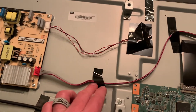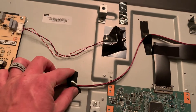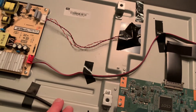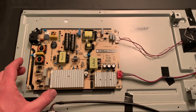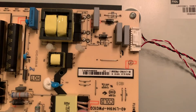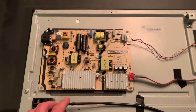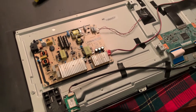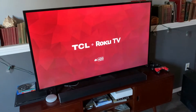At this point you may also want to look at the tape holding the cable routing together. Sometimes it gets loose — you can retape it with some electrical tape if you want. It's not super critical, it just keeps things from moving and shifting around. That is about it — that's how you replace the power supply board. Put the links in the description box below. Make sure you're purchasing the correct board by checking serial numbers and your TV model. Now we're going to reverse this, put the back on the TV, put the stands back in, and fire it up. The TV is powered back on and working.